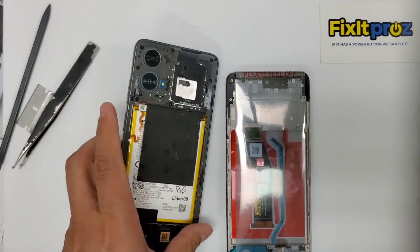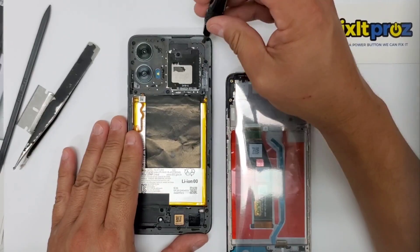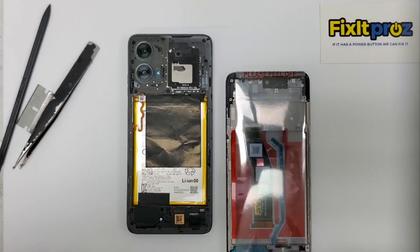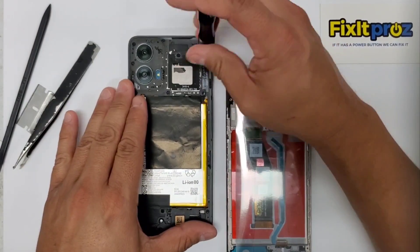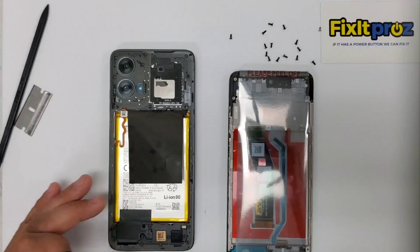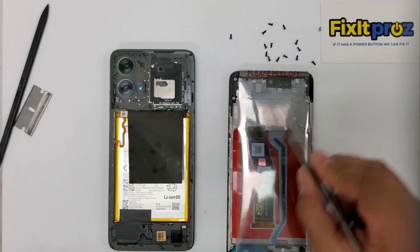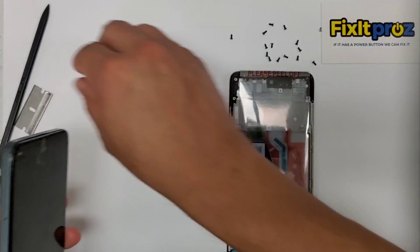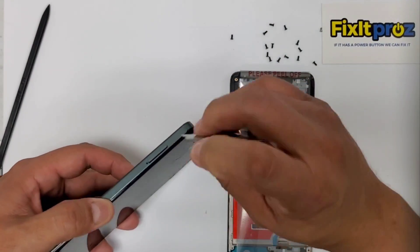That opens up when you're here, and then we'll start taking out these screws. I'll kind of just pause this video for a second and we'll get to the last part. So there you go — I removed all the screws. Every one was the same except this last silver one right there. You don't have to worry about it. So now take your spudger. First, take your SIM tray out. You can use those poppers; I like using a blade. Take that out.